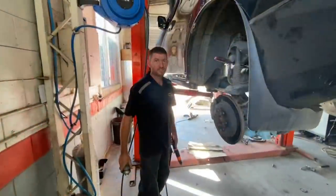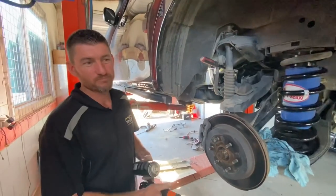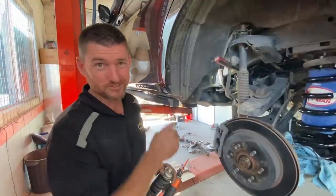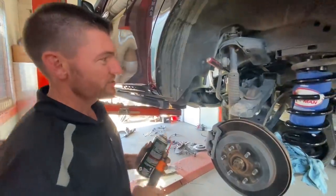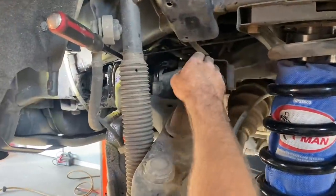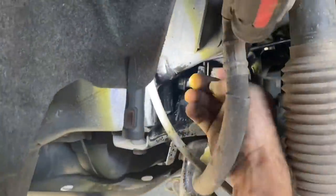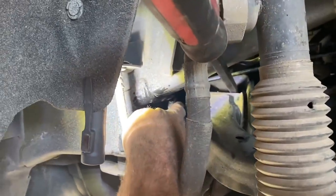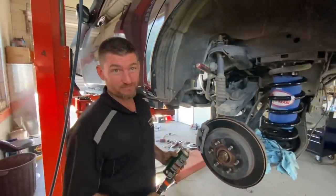Now the dreaded bolt that's backwards - everyone loves this one. Do you cut it out Steve, or take the K-frame down? I took the K-frame down once and decided I'd just cut it instead. With the rear control arm, the bolt going in this way - take the other bolt completely out first, then undo the nut and push the bolt back as far as you can. Put a lever bar up in there to jam it and keep the bolt still, then cut that bolt clean in half with an air saw. Once it's in half you can get it out easily.